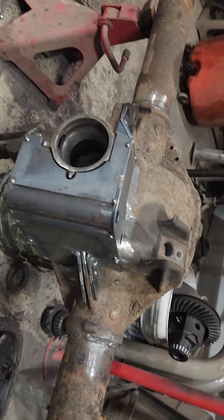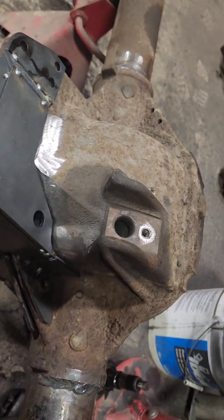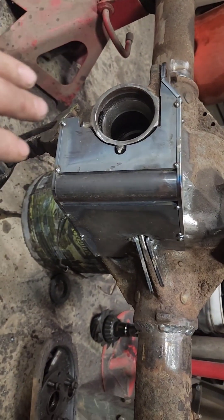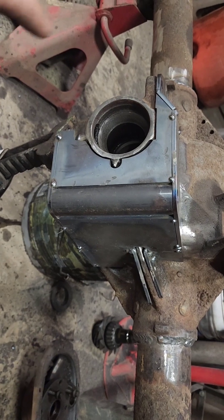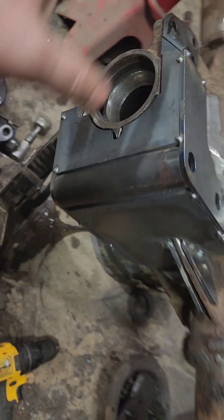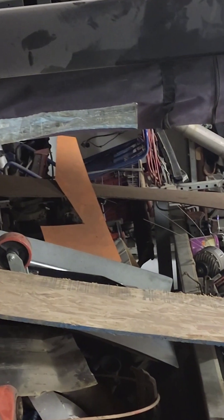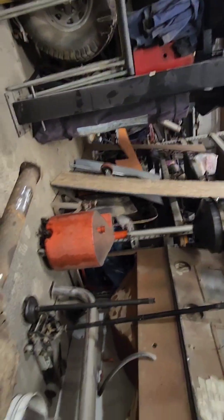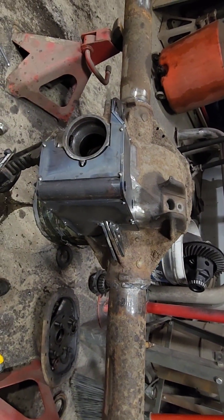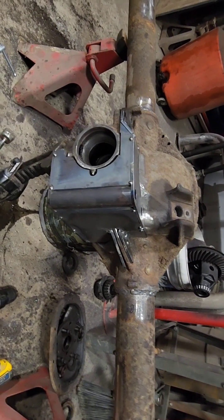The back side is actually fully welded. I need to go through and fully weld the front side, but for the most part that's all done. Got to come up here and clean up a few more spots, weld the outside of it, let that cool down. I gotta dig out the old buzz box because I gotta use the nickel rod to weld this all in, and I haven't stick welded in quite some time, so we'll see how that goes.